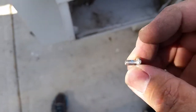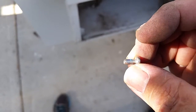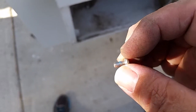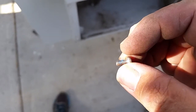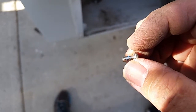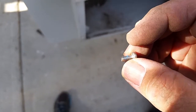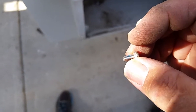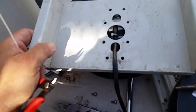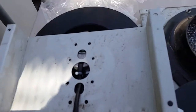It's probably going to be medium-strength Loctite — or it'll say 'removable.' You'll definitely want to put Loctite back on these screws after they're cleaned off and reinstalled. The reason they have Loctite is because of the vibration these fans make — without it, the screws will wiggle out and cause another fan failure.